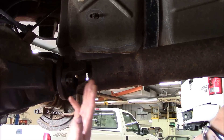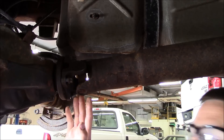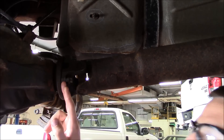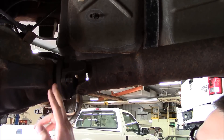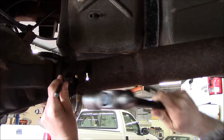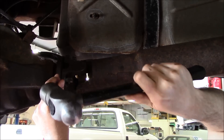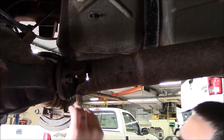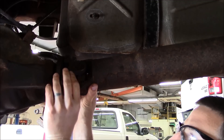We're on step seven — we're going to remove the drive shaft. This doesn't have to be step seven; you can make it step one if you want. First, we're going to mark the drive shaft so we put it back together in the same place. I make a dot here and a dot here on the yoke, so when I put it back together I know the two dots line up. Then spin the drive shaft bolts out.